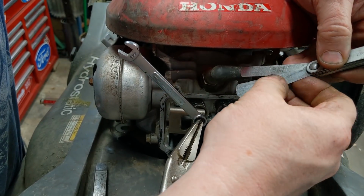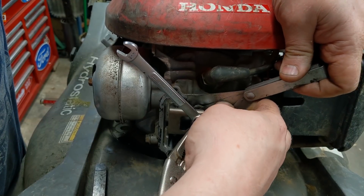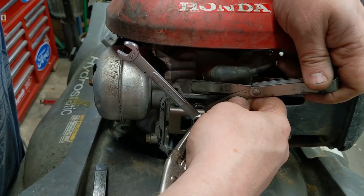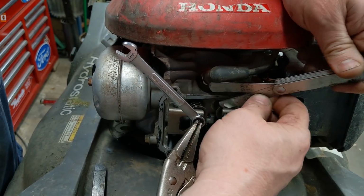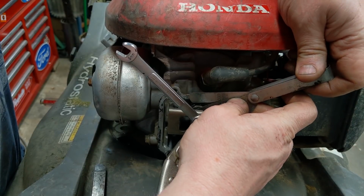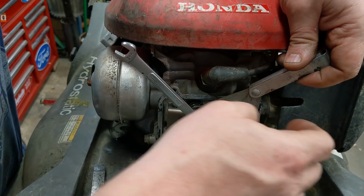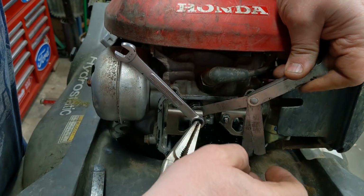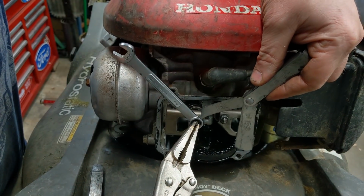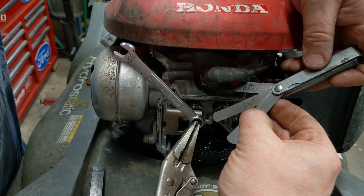And it is tight. Now I'm going to try my 8. Actually, my 8 goes in there pretty good. I'm going to try my 7. My 7 actually just falls in and out super easy. So that kind of gives you an idea. My 8 has a little bit of drag. And my 9, I should not be able to really insert it back in without like bending. See? So this gives you a great idea doing the 3 feeler gauges. I can get it in there, but there's definitely friction. So this lets you know what light drag is.